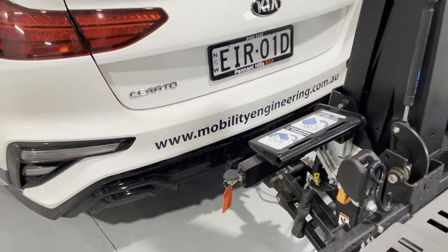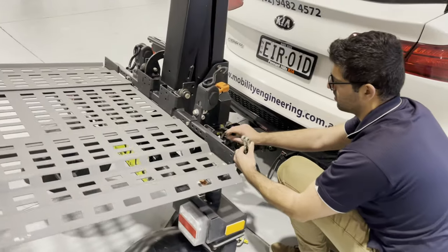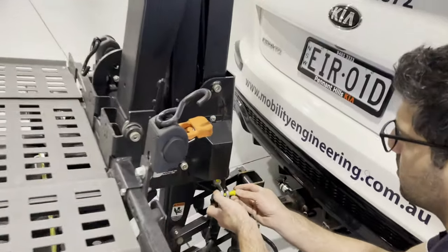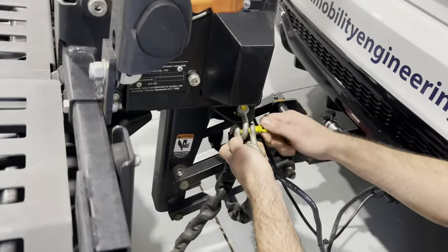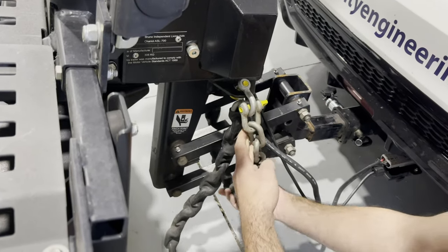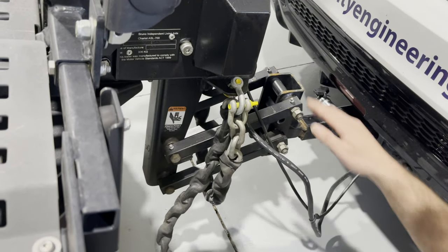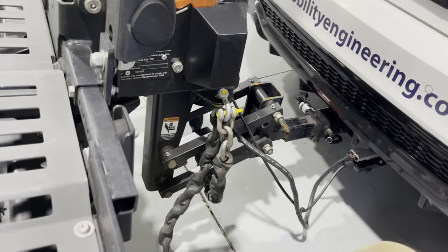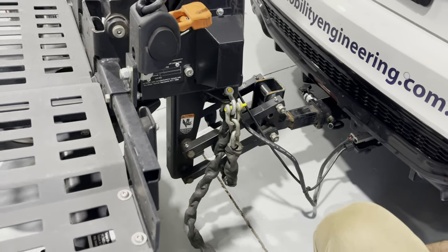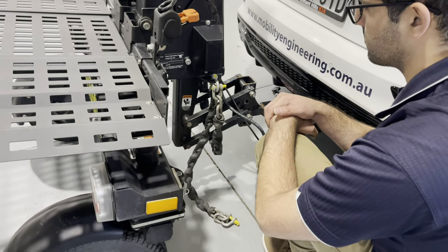What's really important at this part of the step is to bring one of those chains around and hook it onto the connection point of the other chain. You bring the chain from the left around to the right, and there's a loop that forms underneath the whole Chariot hitch. The idea is that when we pull it out, it's not going to drop and hurt someone. It's a very important safety step — also very important to disconnect those safety chains or safety cables.